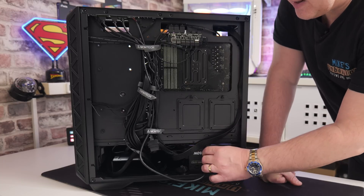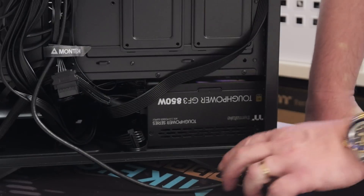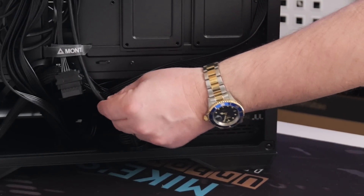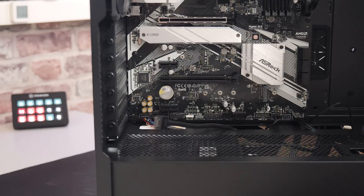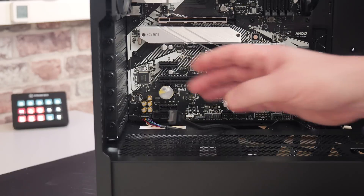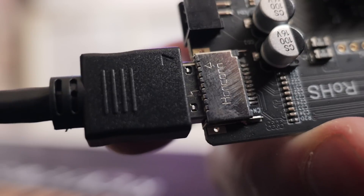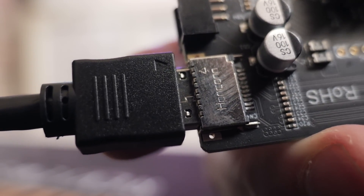All you need to do is pass this through underneath where your power supply goes or somewhere along the bottom section, so you can run the cable to the inside. I would suggest passing as much of the cable through as you possibly can to give you a little bit of slack on the other side. Also, something to pay attention to is that on the cable there is potentially going to be a little triangle or an arrow to say which way around it goes, because these aren't actually universal — they only fit in one way. I'll give you some close-ups so you can see the card and also the cable at the same time, so you can see where those notches should line up.